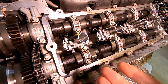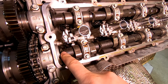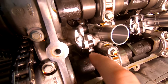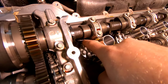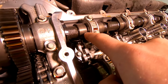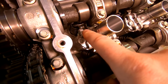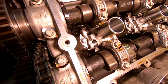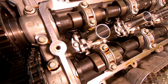So now we've got some things figured out. As I said, we found the part that was missing here, and I showed you that. And now we figured out what was down there. It belongs right there. That tappet broke. So this lobe is not turning. So one valve is not opening. And there's 16 of them. So one of them not opening, you may not notice unless you're just going full potato in this thing because it's ridiculous power.